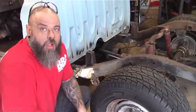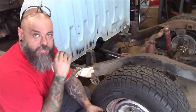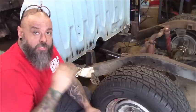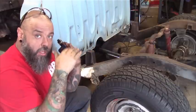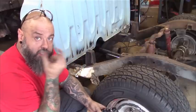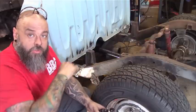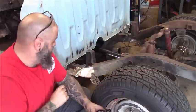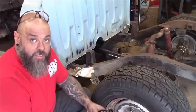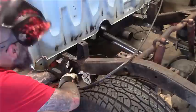Alright, well, it's all welded up. Now, you might notice that I had to stagger the frame. Now, the reason is the frame actually changed diameter going back, and it sloped up. So in order to keep everything straight, I had to shift it right at a 1/2 inch. So I took 1/2 inch solid stock, slid it in there and welded it out, so that way there's no open gaps, and filled it all in. So now I've got to sit and just grind until I get it all smooth so I can put the fish plates on the side.